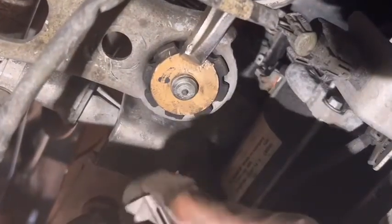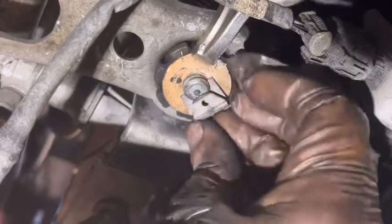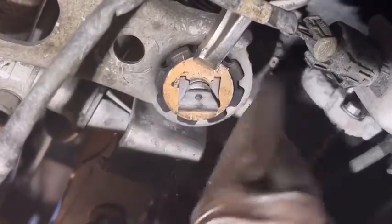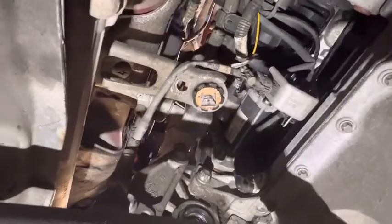Right. I'm using locking pliers like this, then after that this tip came out, then after that I can install this clip. Right, see, it's in. Now after that I can remove the locking pliers. Right, that job done. Next step, I'm going to line up this Tipp-Ex mark, otherwise your inside gear lever is going to play up. Right, leave it like that and tighten this screw.